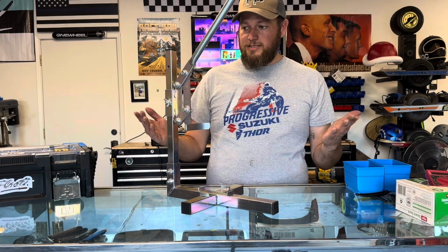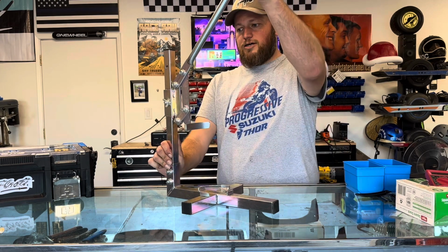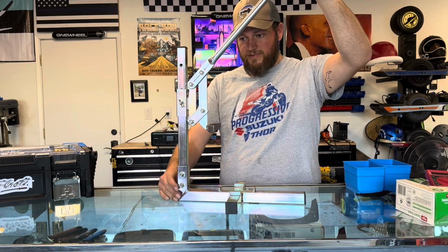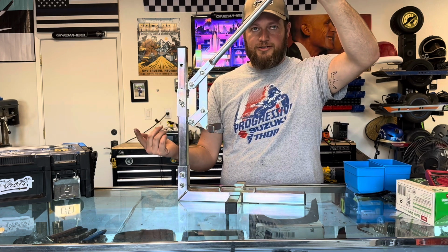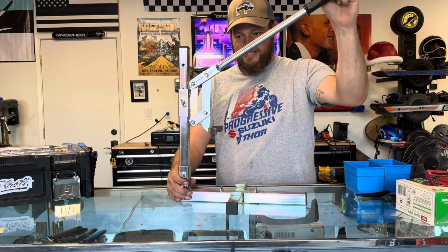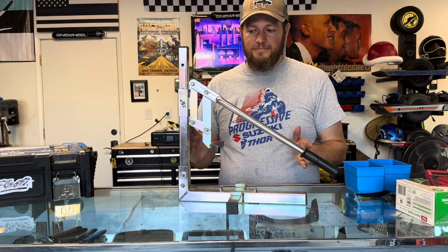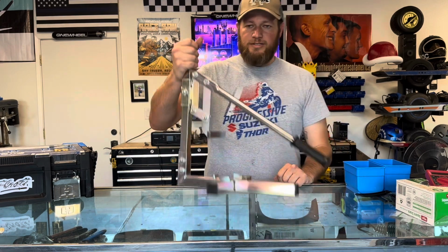All right, surprise. So next, this is the tire remover. I absolutely love this thing. It's great for pulling off or breaking beads on your one-wheel tires. This one is from Craft and Ride. Some assembly was required. It's pretty straightforward. If you're changing your own tire, you should be able to put this thing together. Basically, you put the tire in here, press down on this, and it gives you the leverage you need to break the bead on the tire. It saves you a lot of time. Not necessary by any stretch of the imagination, but if you're going to be doing a lot of tires, it's nice to have.